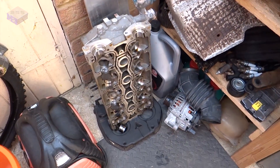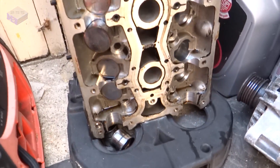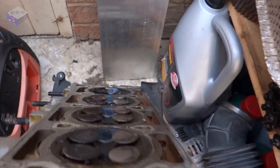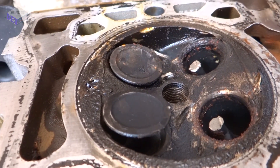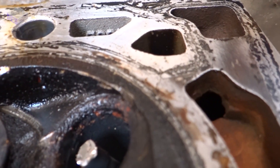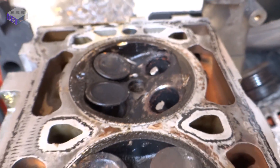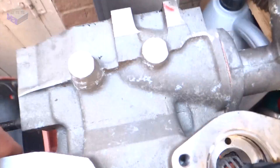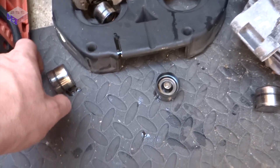This is the head of the MGF and it looks okay from this side. But if you have a look on the other side, you can see where the pistons met the valves and they disagreed. There's also a tiny crack just in the middle of the frame there, so all the water came through and was sitting in the sump. When I drained the sump, water came out first and then the oil, because oil floats on water.